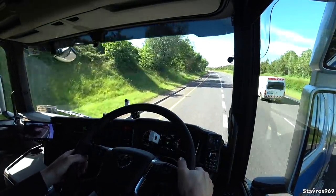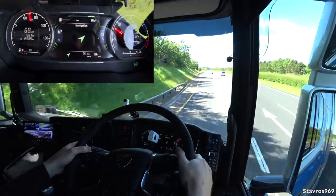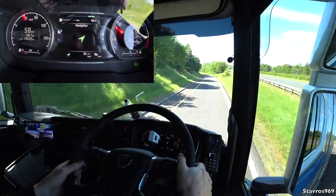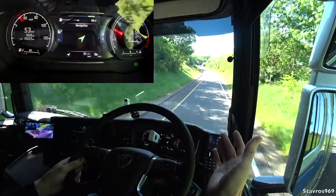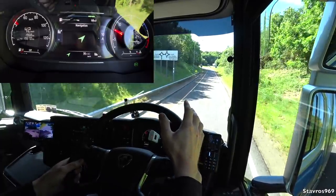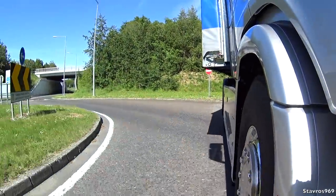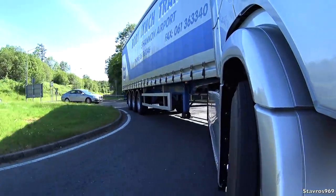Let me just drop it down — the retarder. We're just going downhill here and I won't use the brakes; we'll just use our retarder and save on our brake pad wear. Yeah, the retarder — I love it. It's just slowing us right down to this roundabout at the end of this hill. Five-stage retarder and it'll just keep pulling you back. Still not using my brake pedal. Obviously if we had more weight I would have been pushed more. It just gives you a quick demonstration of the retarder — it's a definite must in any truck, guys. Just get the retarder and save yourself a lot of effort with the brake pedal.